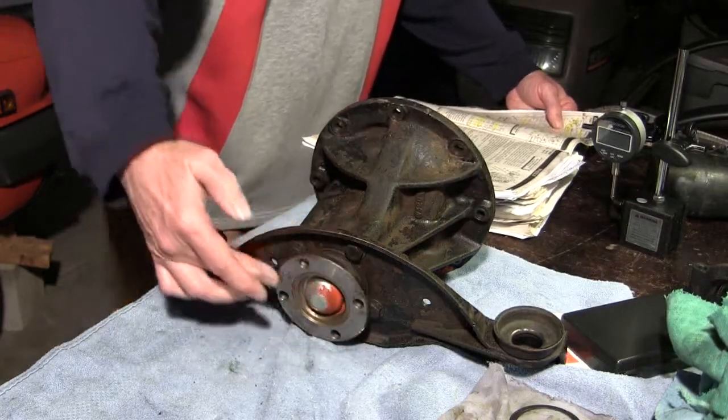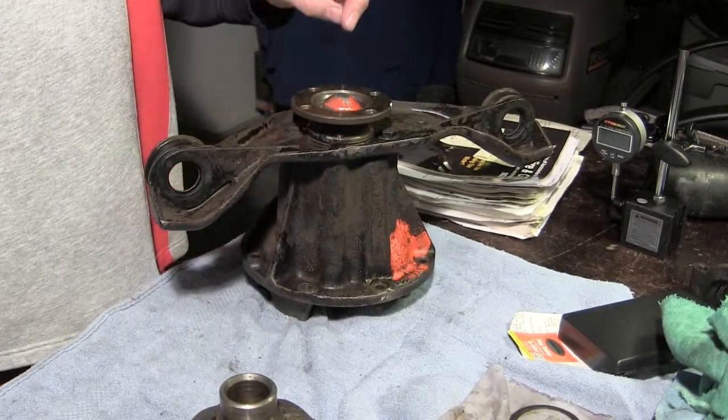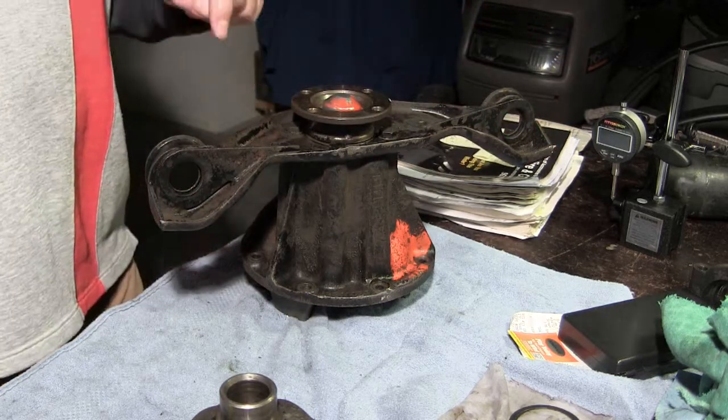71 to 80 Spitfire. I've got to pull this shield off, take off the pinion nut washer, pull this support off, and drive out the pinion.